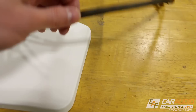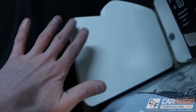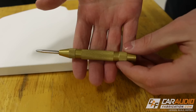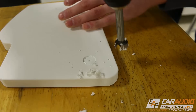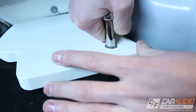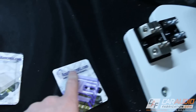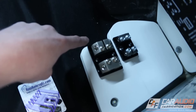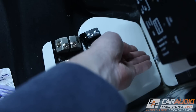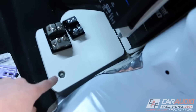If we test fit our shape, everything looks good. Now I need to determine the exact location of this stud, so I took a paint marker, added a little drop on top, put this in the vehicle in the exact position, and pushed hard down. Now we have a nice mark showing exactly where we need to make that hole. With the fuse block mounting board now mounted into the vehicle, I'm starting to plan out the location of my different distribution blocks from New Concepts. The main lead will come in from the battery, and everything coming out can wrap around and go to each of the different amplifiers. I need to drill some mounting holes, so I'm going to unbolt and take this back out of the vehicle to avoid more plastic shavings.